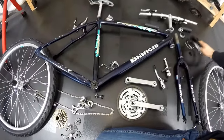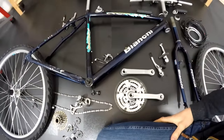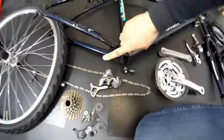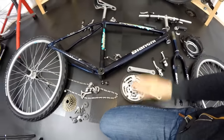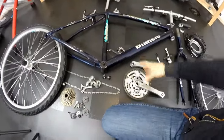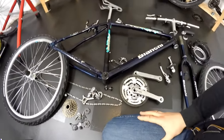I'm already done buying all the cables and housings, because we do that each time we buy an old bike. We also have to replace the bottom bracket because it doesn't really spin anymore. The question is — I was already asking my viewers on the Polish channel — what should we do with the hundred dollars we can still spend? Should we replace the hub and build a 2x9 or 1x10 setup?